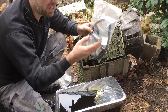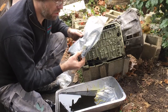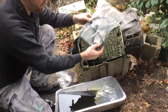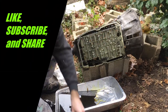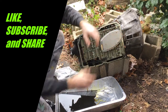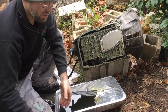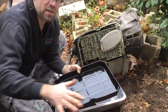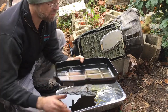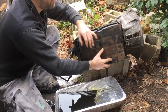This kit is very inexpensive — I think it was around $30, depending on brand and where you go. I would definitely always put a new gasket on. After you put the new gasket on and the filter in, you're going to put the pan back on. You don't have to put any sealant on this — it's a rubber gasket and it'll crush to its specifications. Then put the pan back on and put all your screws in.